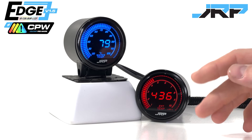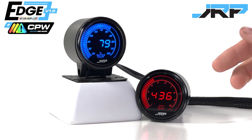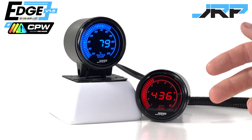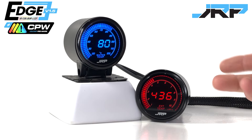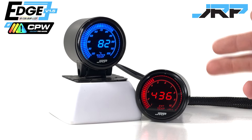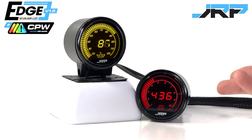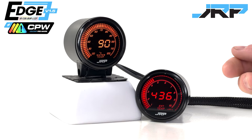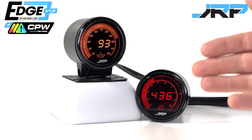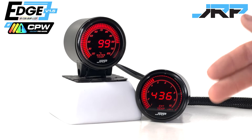As an example, you've chosen to use blue as your desired daytime running colour. Then, set a temp warning at 100 degrees for water temperature. During setup, as an extra step, you can enable the colour pre-warn function. Once the gauge reaches 85 degrees, it will change from blue to yellow. Once it hits 90, it will change from yellow to orange. Then, as you pass 95 degrees, it will change from orange to red. And finally, once you reach 100 degrees, the gauge will sound its alarm.